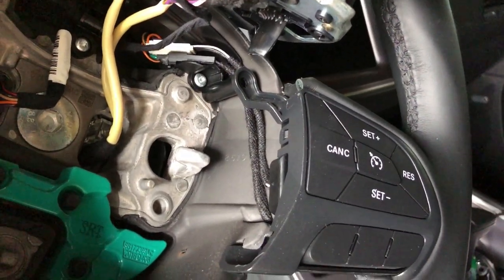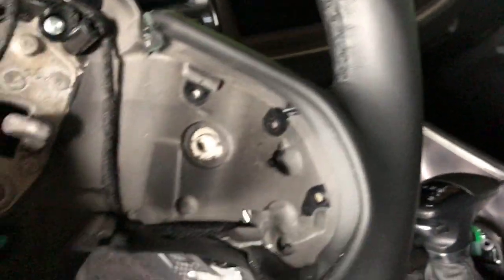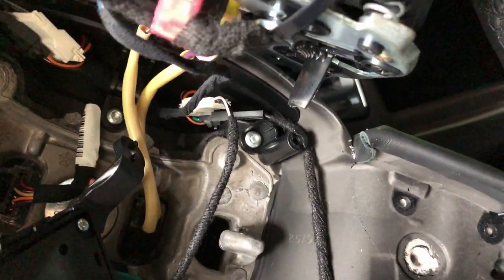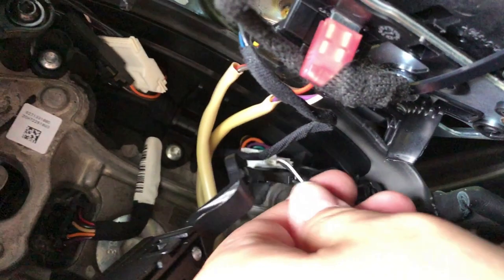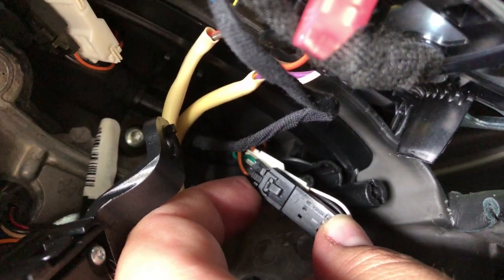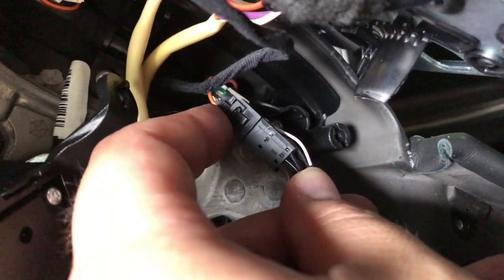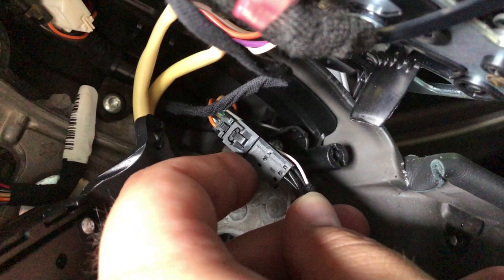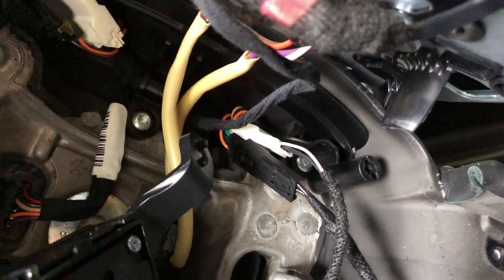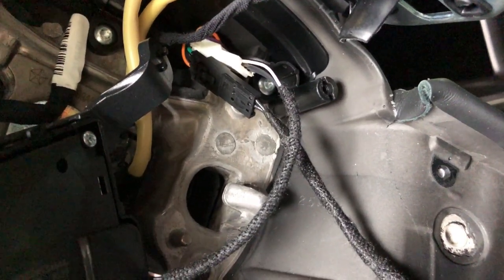Here's a better view of the wiring. You can see how it's tucked all the way in, nice and tidy. When you pull it out it gets all messy, so you can see how it should route nice and neat. These little plugs — you've got to pay attention to how they work. There's a little push tab you push on and then it just pulls right out. Make sure you push enough but not too hard, because in older cars or hot areas the plastic clips love to snap, and then you're looking at a pretty expensive part — that's the steering column wiring harness. So be careful.